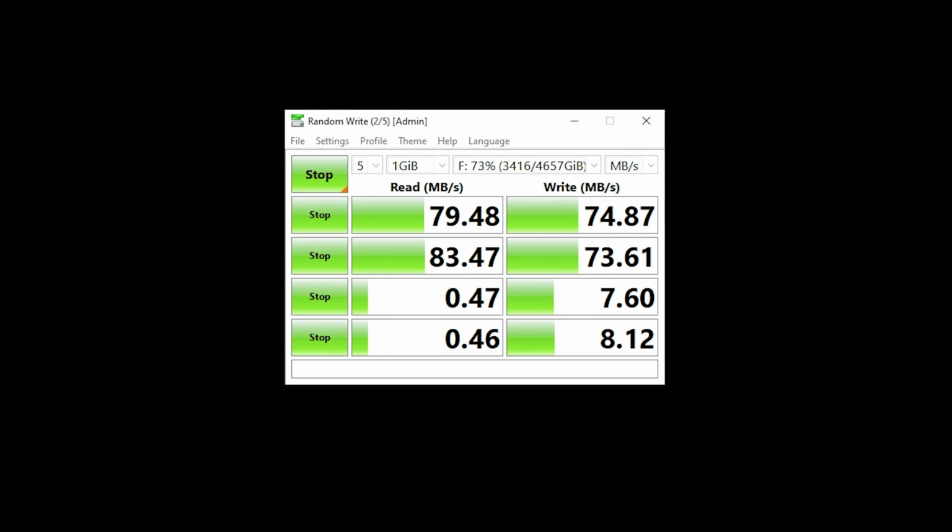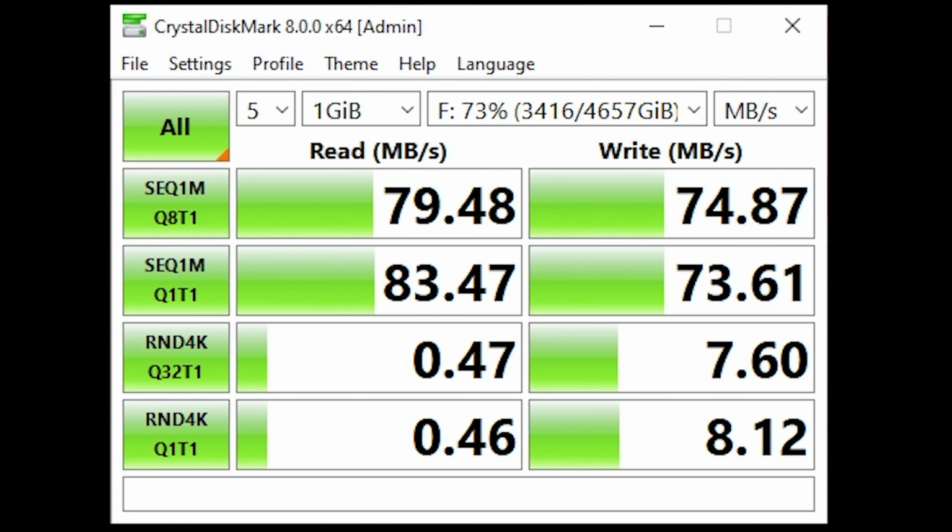Results. The results were a little disappointing, but that could be another issue, such as the hard drive having the majority of its space occupied with many files, or the stock cable can't handle the transfer speed. To find this out, I'll be benchmarking the new external hard drive that is exactly the same, which I purchased on Black Friday, and test both with a new Gen 2 cable in the future. Shouldn't, as USB 3.2 Gen 1 is theoretically 5 gigabits per second. Again, it'll be formatted in exFAT and use everything that was the same.